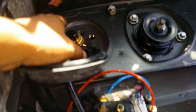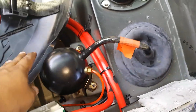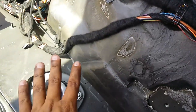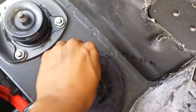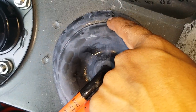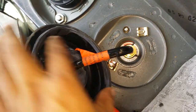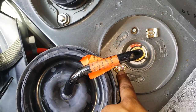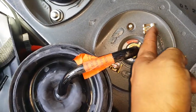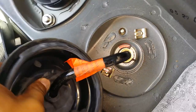This is the passenger rear, and I'm gonna go to the driver's side — this is more likely what you'll encounter. When you remove the panel and the cover, you have to remove this rubber piece before you start pulling stuff off. Notice that this piece has an arrow — it has to go with the arrow facing this way. Once the cover is removed, these are the pins. All you have to do is slide them out.